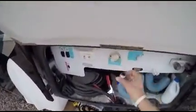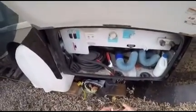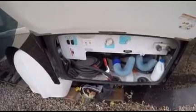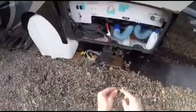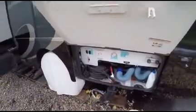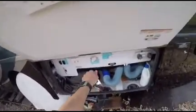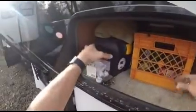And then again, when we go to the other side, at the sewage, I just want to show you, I just left this here, though this was, again, turned into the freshwater inlet. And I made this up, I seen this online. You just add a female, I think it's a 1/4 inch nipple inlet, and then you add that to, they sell these plugs in the hardware store. So this will screw right into your water line, and then the nipple screws right into this thing. And that's real handy, because that way you don't have to hold it. Now you can sit here and just hold it up against, they make the conventional ones where you can just hold it up in there, like you can see right here. But who wants to do that for 5-10 minutes? So I just figure make one of these up. It's a lot easier.